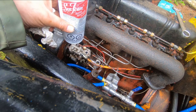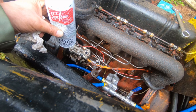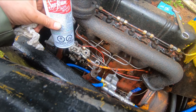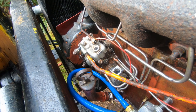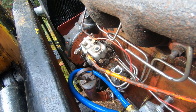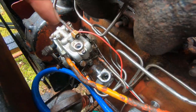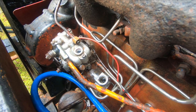I've filled up both the inlet and the vent port, so the governor chamber is completely full right now. It wasn't down that far - maybe the depth of the cover - so it looks like the bowl might have been completely full anyway. I put seafoam in there, which is a concentrated solvent. Let's crank it over and see if that disappears or goes down any amount. Okay, so it's obviously moving it through the pump and into that chamber. I can see it's coming out of the return line. So it would seem that the lift pump is doing its job.